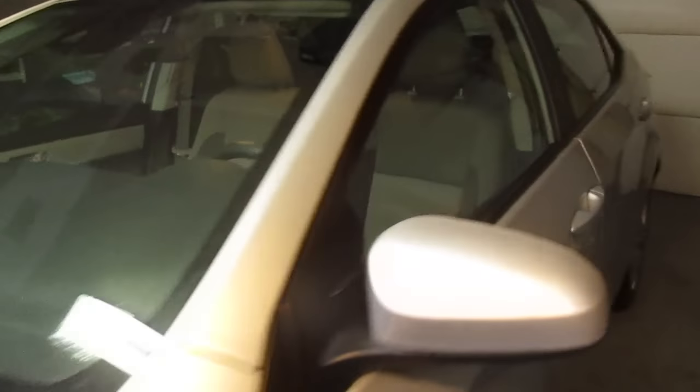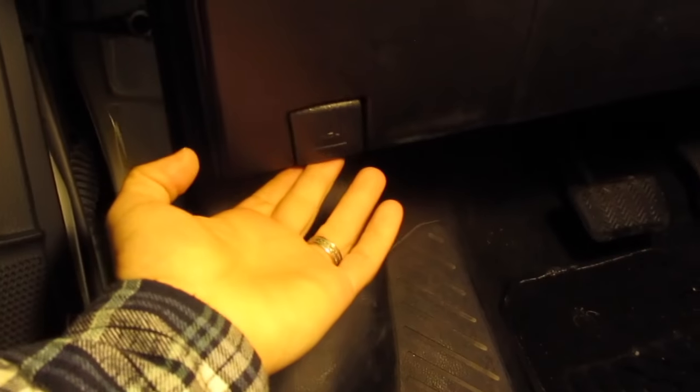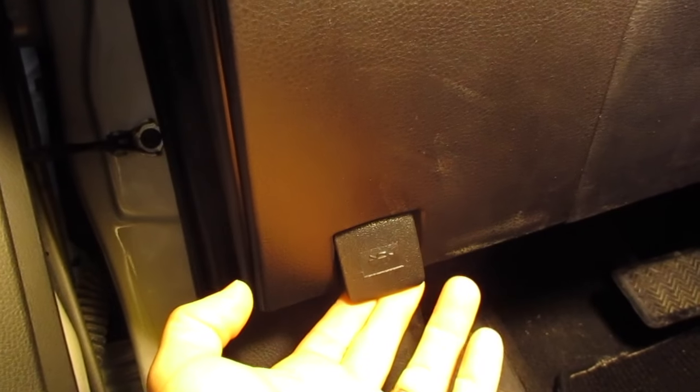I have a 2017 Toyota Corolla here. I'm going to show you how to get into the hood. First thing you're going to do is open up the door and then come to the floorboard where your left foot would be and look straight up — you'll see a little tab with a picture of a vehicle with the hood open. Pull that forward and you'll hear a pop. That's the primary release.